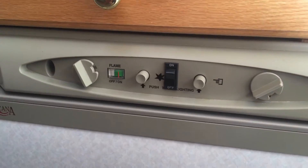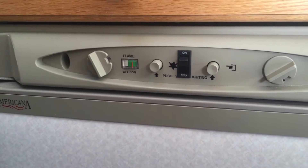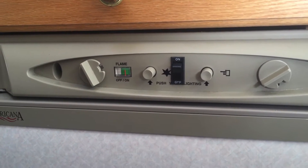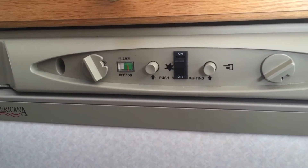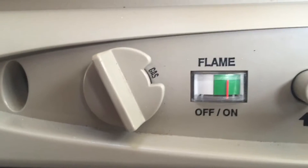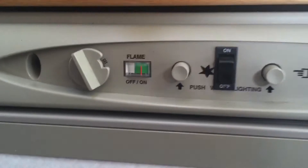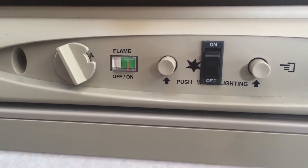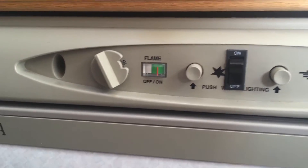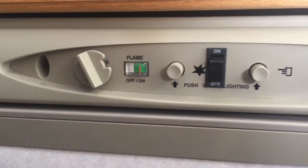Your refrigerator is a three-way refrigerator, so it can run on 110-volt, 12-volt, or propane. When there's no 12-volt and you aren't hooked to shore power and the generator's not running, then obviously your only other choice to run the fridge is on propane. This little indicator says your pilot light — there's a little flame in there that makes the refrigerator cold. It heats up the ammonia and there's a phase change, and that's how it makes the fridge cold.